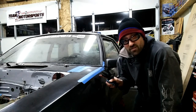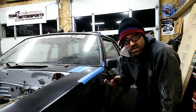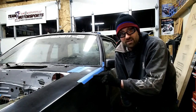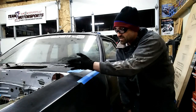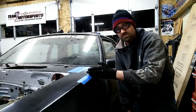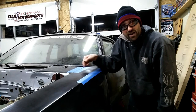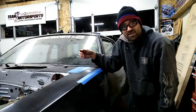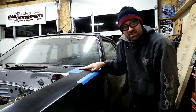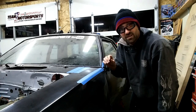Here is the driver's side fender. I did the same thing on the passenger side as I did on the driver's side. I end up splitting it all the way down and measuring this to about 12 and a half inches — literally from the edge of the cowl straight out, about 12 inches right at the edge of the cowl. I put in two bolts from the cowl inside going out into the fender, measured the same, drilled them, tightened them, and they fit just about as well as the passenger side. Not exactly perfect, but within a tolerance that I can sand and fit it to make it fit well.